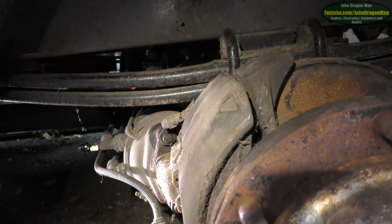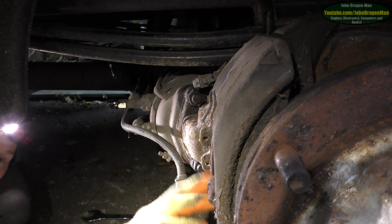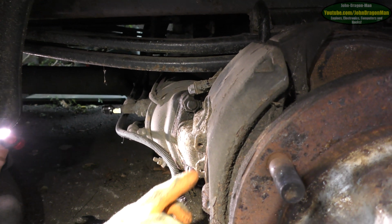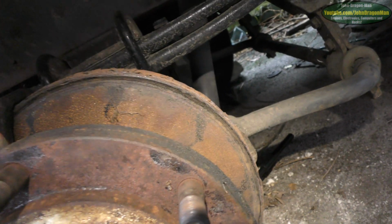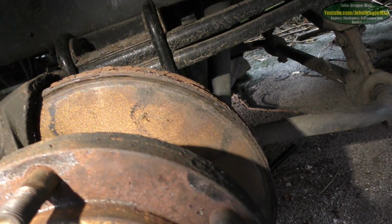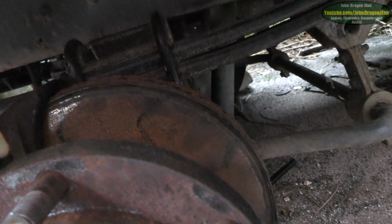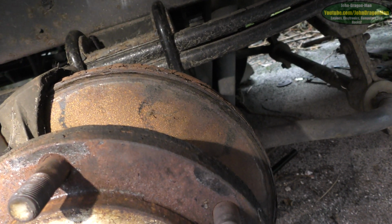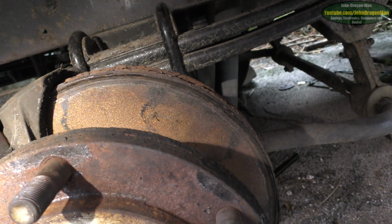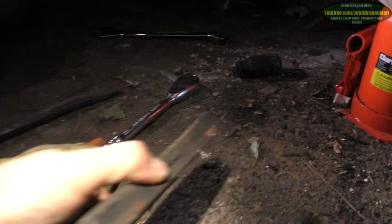So we're hoping that's why it had a parking brake efficiency fault, because this hasn't been worn properly compared to the other side. Right, we'll brake a bit while we go down to the MOT place. That's what we'll be doing. Bed them in a bit. Right, we'll chuck them pads back in again. We'll probably swap them round, actually, so they're on the opposite sides.